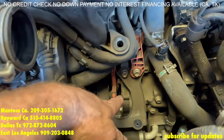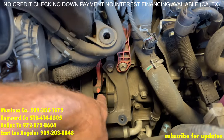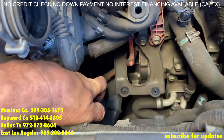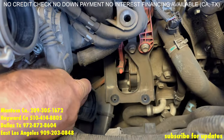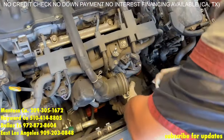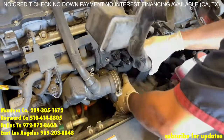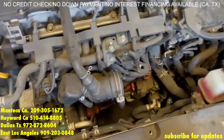To make the job easier, you're going to remove the three 12mm bolts — you have that one, that one, and there's another one back here. Also push this tab in, and once you remove this, the air box down there will be easier to remove. It's a bit of a pain to remove sometimes, but it comes out. The hoses get stuck on there.